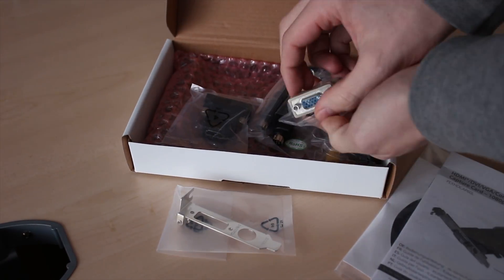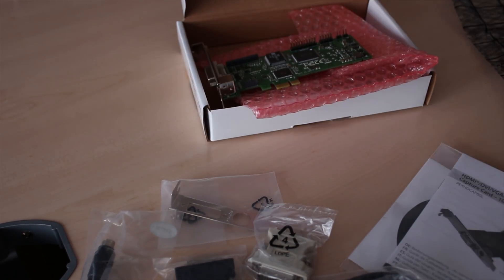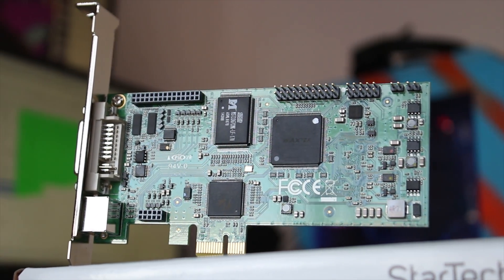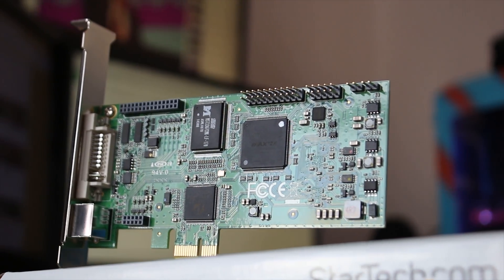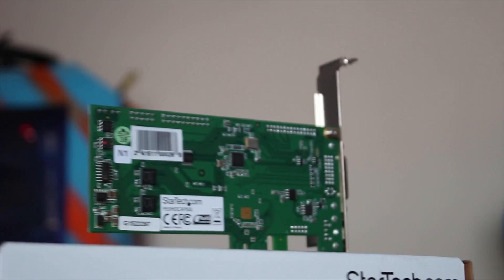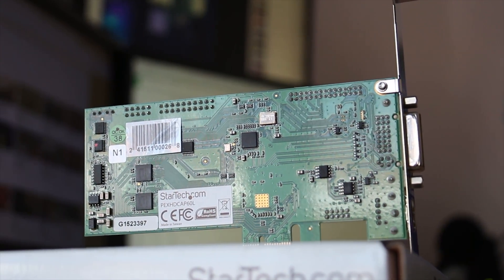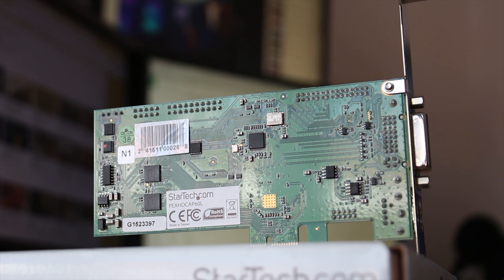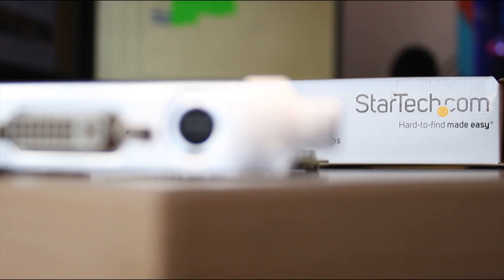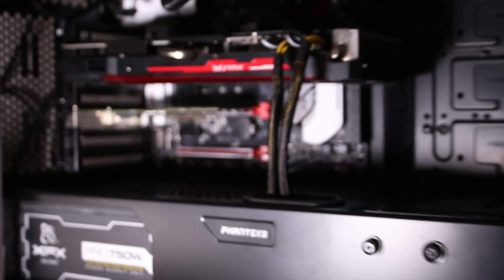Also included is a half-height bracket and quite a few adapters, including a DVI to HDMI and DVI to VGA, as well as S-Video to composite adapters including both RGB and the more standard yellow, as well as left and right audio jacks. The card itself has a PCIe 1x connector as well as quite a few jumper and header connectors, and quite a few chips on board, one of which is a dedicated H.264 encoder. The rear outputs are the S-Video and the DVI ports, and the DVI port does allow for audio in, as does the S-Video.